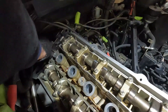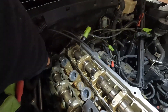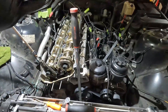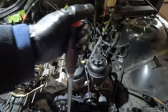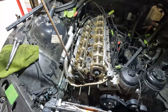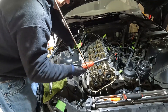I have to take off my timing tool — loosen that up, move it out of the way. You can't take the camshafts off at top dead center; we actually have to be 30 degrees off of TDC or you can damage something. So I've removed the timing tool and now I have to rotate the engine 30 degrees. Straight up to straight sideways is 90 degrees, so just past the power steering reservoir should be the 30 degrees I need. You can see my chain's up out of the way — there it goes — and now it's safe for me to remove the camshafts.